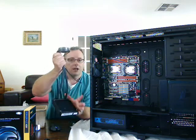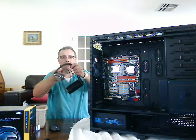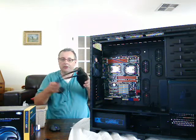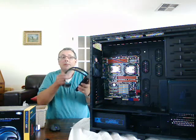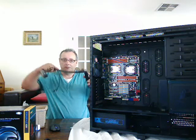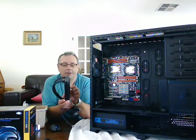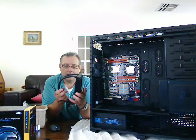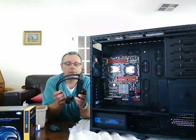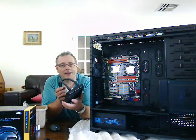The Corsair pump looks to be about two and a half inches high. Secondly, reading or listening to the YouTube reviews, it was very obvious that the Corsair tubing was a lot stiffer and so more difficult to manipulate inside the case. I thought that might be an issue for me, so I'll go for the one that's far more pliable — this is just made of rubber. The radiator on the Corsair one is identical to this one, unless I went for the next model up, which was their H70, and I would have been paying quite a bit more for the H70 compared to the Antec.